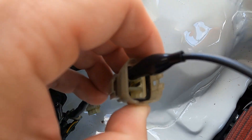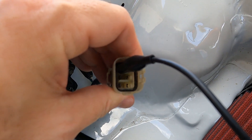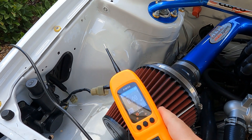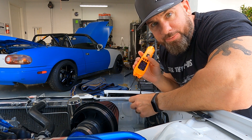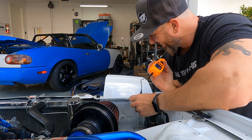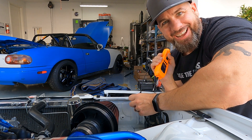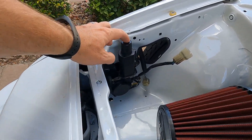You're probably wondering which one of these four remaining wires is the power to move this up and down. I could refer to the instruction manual, but I'm just going to go ahead and give this thing some juice and see what happens. Quick tip: if you're using one of these, instead of probing to the metal connector and then pushing the up arrow, push the up arrow first and then make the connection. Did you hear that? Something happened. How about that for a result — it worked! Let's see if we can put it down. So just like that, we were able to prove that our motor is actually fine. This is the most expensive part of the whole system, so awesome news — we don't have to jump on eBay and try to find a used one.